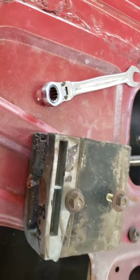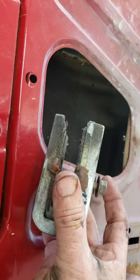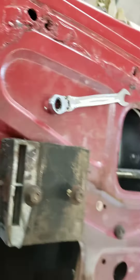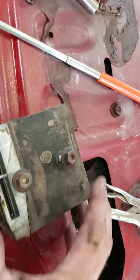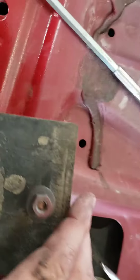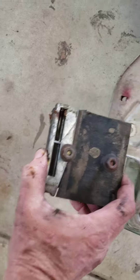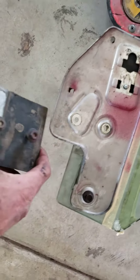With the door open, there's not much magic to it. On the inside, you've got these guide blocks — pretty big, pretty heavy. There's one at the rear of the door and one at the front. They're just held on by two nuts and a bolt to the window. Take those nuts off and you can pop it out from underneath.